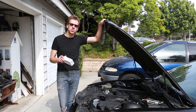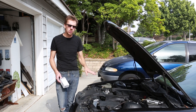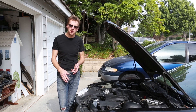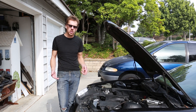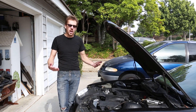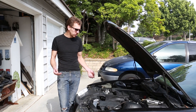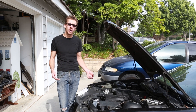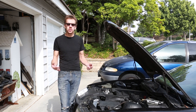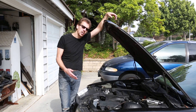If it's the upstream or intake sensor, it will probably be causing a little bit more problems. You'll notice that as you try to accelerate, you'll see a loss of power. And of course it will also trigger a check engine light that will probably say something like camshaft position sensor, circuit one or bank A. Usually that's the intake or the upstream sensor and not the exhaust sensor. You can confirm that with Google, and you can also confirm it if you see a loss of power.